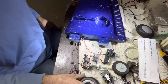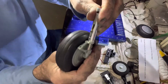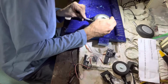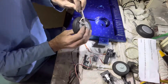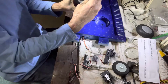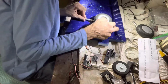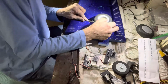Now this one, like I said, it's got the suspension on it. Got the little scissors there on it, I call it. I don't know what you call them, thing. But it's gonna come down. My wheel is pretty much gonna be centered there. So just a little bit of shaving, right here to get this to miss it. So it's gonna come up and be pointing forward. Down, forward, down, forward. So yep. Center my tire. It ain't gonna be much. I mean, actually, if the thing would come straight down, it'd probably miss it completely.